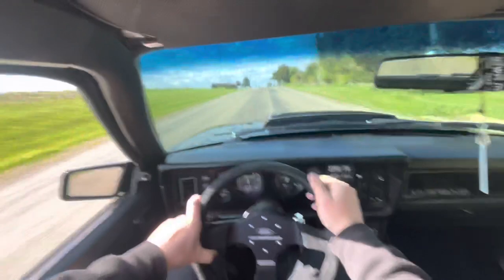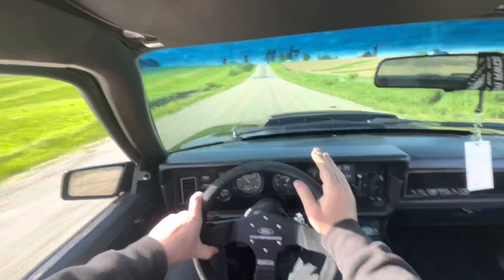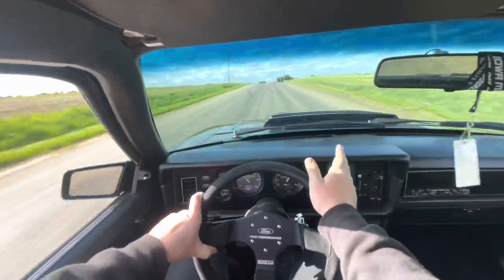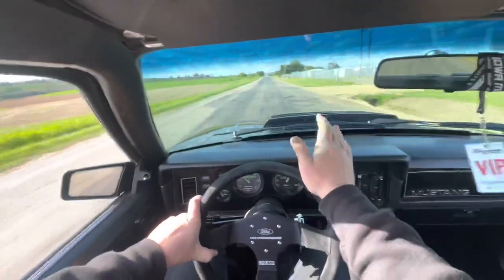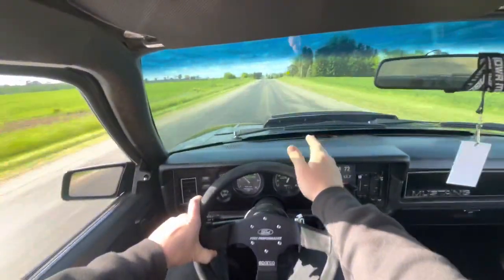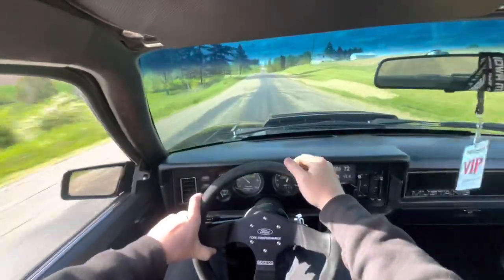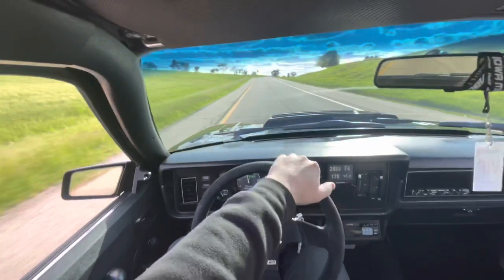You can also run the A/C through the Sniper so the fans turn on automatically when the A/C is activated — very nice feature. Sitting here cruising, it's a hundred times better than my old carburetor. I went through a 600, a 650, and a 750. You can be the world's best carburetor tuner and you'll never have it tuned better than EFI, because EFI handles all the variables — 60 degrees, 100 degrees, even 150 degrees outside, it starts right up, no pumping the throttle, no choke.